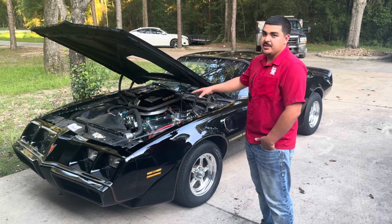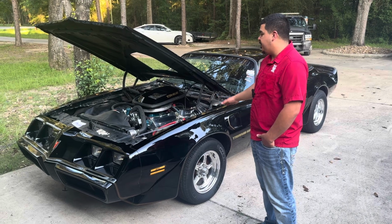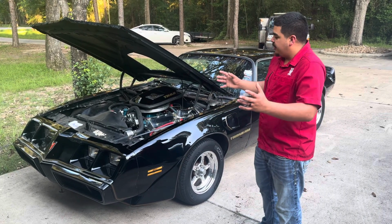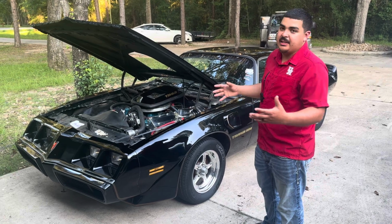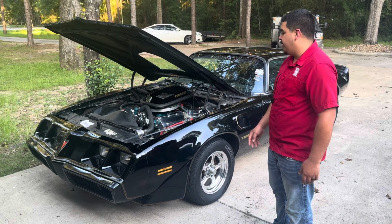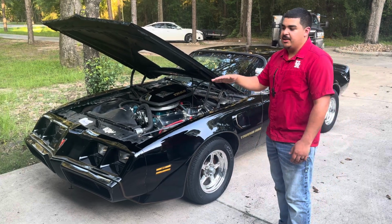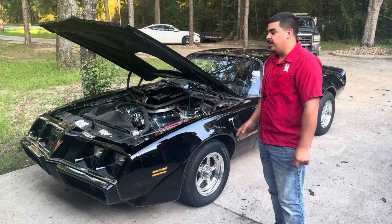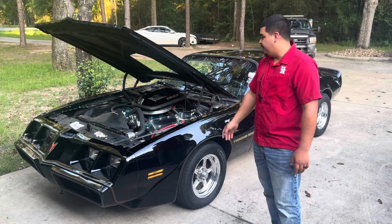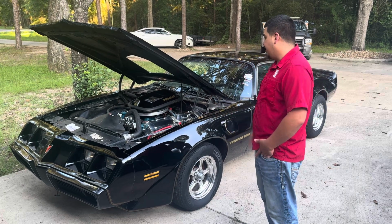And because we're changing the head package on it, we had to change the intake manifold because the original intake manifold would fit a 403. Although those engines are dimensionally the same on the outside, the motor mounts are the same, the bracketry is the same, the head and intake and all that combo up top does not interchange with them except the distributor, because that's a block thing.